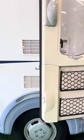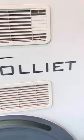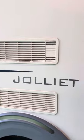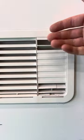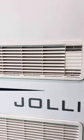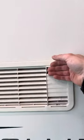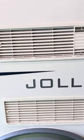Further towards the back, just behind the door here, we have got these two vents. These are quite important — if you have the fridge lit up on gas, you'll be able to feel hot air coming out through the top right-hand side of the top vent, which I can do right now. That tells us the fridge is working as it should. Physically putting your hand there and feeling the heat proves to you that it's on.